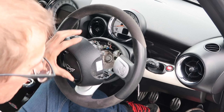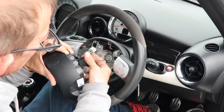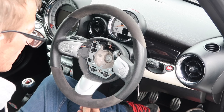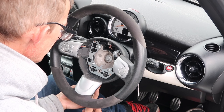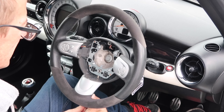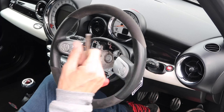I'll show you again with the airbag removed. You can see the hole there — insert the tool back under. What you're looking for is that bar there. When you press that bar it releases the tops. That's the mechanism you're looking for. To unwire it, there's a spade and a clip — push to release. Once you've got to this point, you just crack off the nut and give it a good tug.